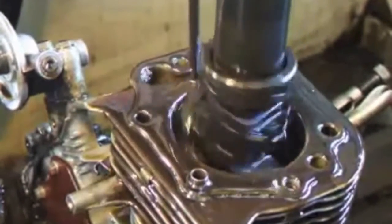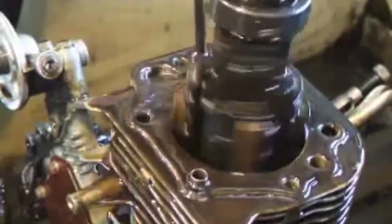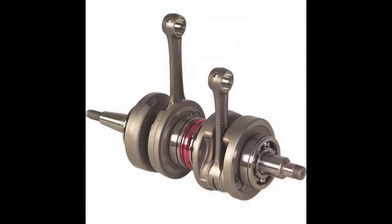Honing uses abrasive stones to leave the cylinder with the correct finish. It is done after boring or if new rings are being installed. The purpose of honing is to leave the cylinder surface in a good condition that helps the rings break in. The hone puts cross-hatch scratches on the cylinder wall at a 45-degree angle. These fine scratches trap oil during ring break-in. Once the cylinder has been honed, it should be washed thoroughly in hot soapy water and lightly oiled to prevent rust.